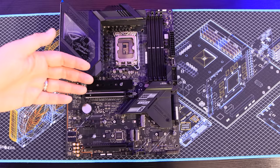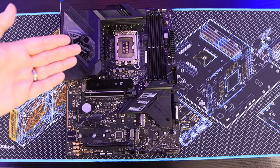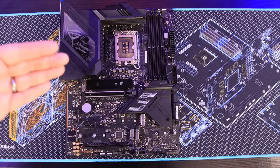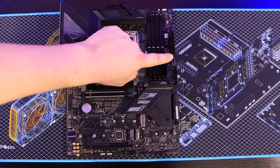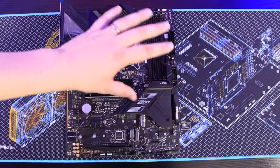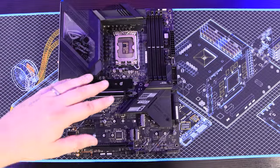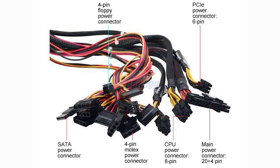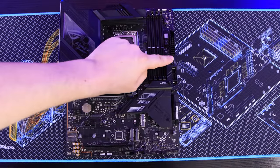Now let's look at power connections. You need to plug in your power supply — which may come inside your case or be purchased separately — and make sure it's a high enough wattage to run all your components. The main connection is the 24-pin motherboard connector, which powers most things on the board. Older motherboards may use a 20-pin connection instead; power supply cables often come as 20+4 pin so you can use them for both, but generally you want all pins connected.